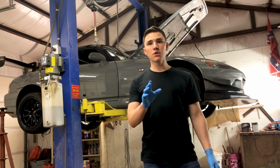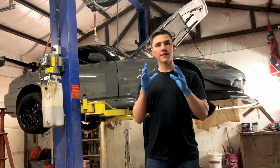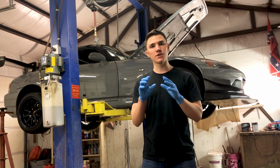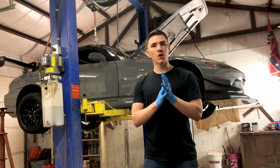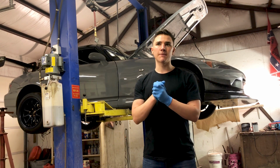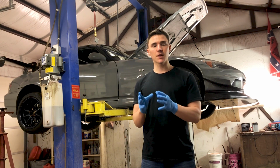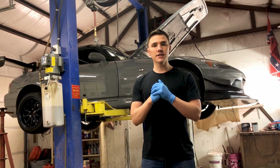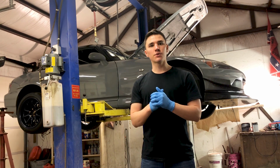The lower control arm bushings, I chose to go with the Mugen hard racing bushing just because they're a similar OEM design. Actually, they're pretty much the same bushing, besides they use a harder rubber. There are other options, but Hallett Sport sells spherical bushings, which honestly would probably be better for track use, but they probably won't last as long as the OEM style bushing. There's also Energy Suspension as well, but I chose to go with the Mugen Racing.